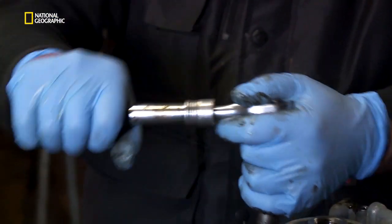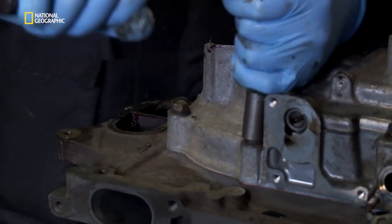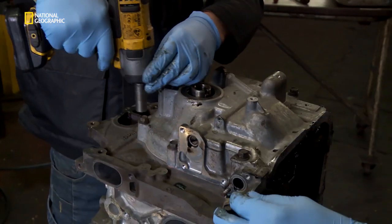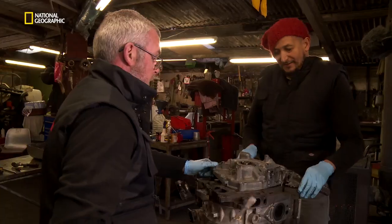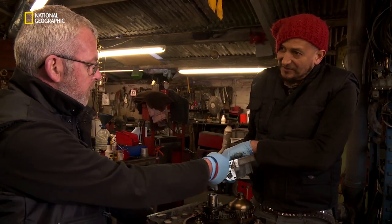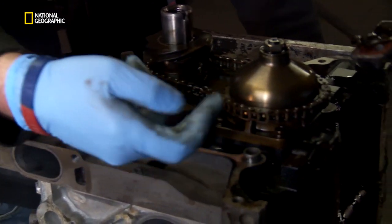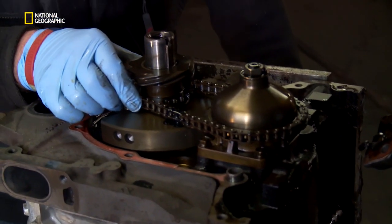Just like any engine, the number one part is the oil — you can never have too much, because the oil is cooling as well as lubricating. This is the timing cover, and it runs the small bearings and also houses the oil pump. There's still not a lot under there — there's the drive for the oil metering pump, which comes in here and runs on this gear here. This chain goes to the oil pump, and that again is driven from the eccentric shaft.